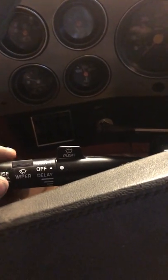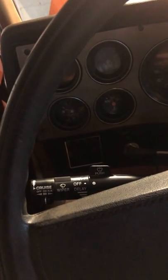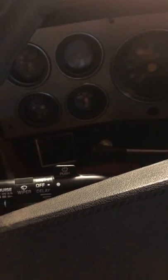Cruise control on this does work as it should — pretty simple hookup. There are four wires. If you have a power probe, you can find the hot wire, which is a pink wire, and hook power to it and just turn these on and off. I believe the on is a gray wire, the set is a blue or green, and the resume is a blue or green. You can hook those right up straight into your LS swap. If you don't know what wires to use, you can get on LT1.com and do that.